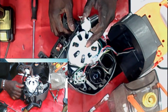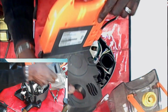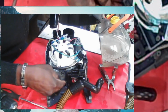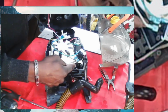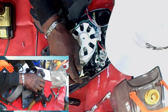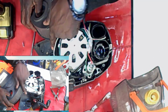It sits right here, right behind this guy. See this hole? That hole is sharing the suction from the motor. This motor is generating suction down below at the base here. The moment the motor turns on, this tubing pulls some of that suction and it's directed this way. Not a whole lot, but enough to start activating. Honestly, this is really to keep this part cool, this motor that's going to be burning and running. I think the Bissell 2X has a similar motor setup where the suction here is pulling this.